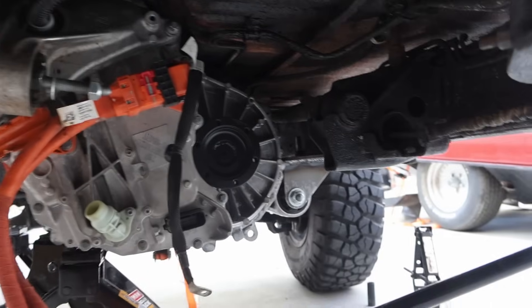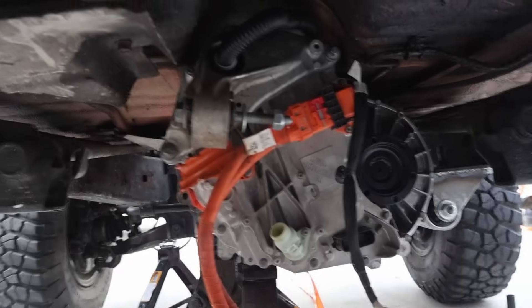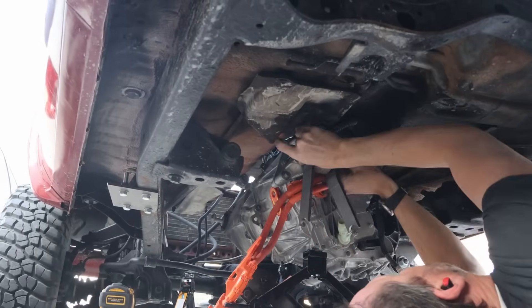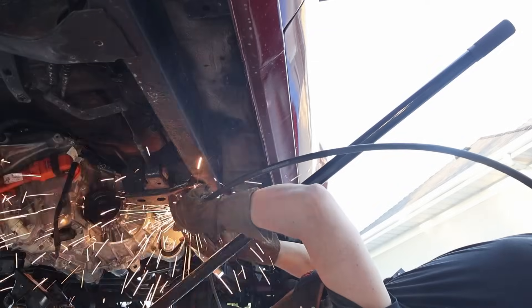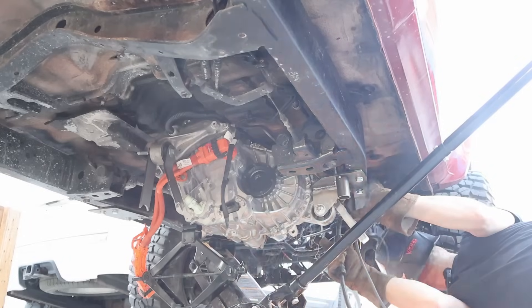We've got the motor — one mount is in position and we just jacked it up as high as we can. You can see at the very top there's very little clearance. I might need to drop it down just a titch so if the motor rumbles a bit it doesn't hit the transmission tunnel, but we're pretty close. I think this is about where we're going to have it. Now it's time to weld on the tubes we have and get the supports for these other mounts.